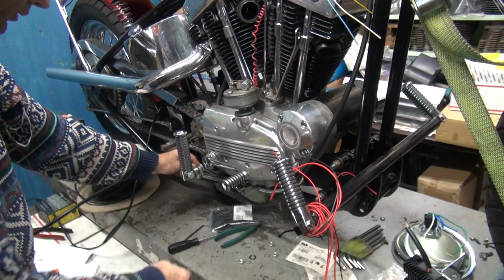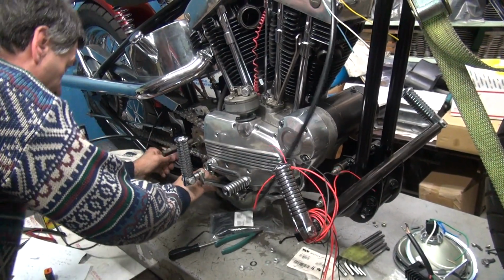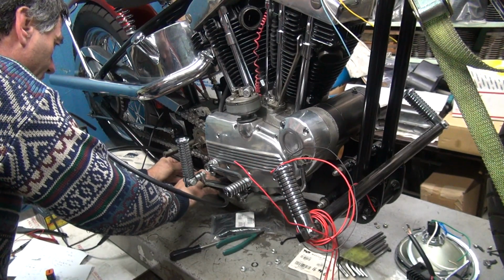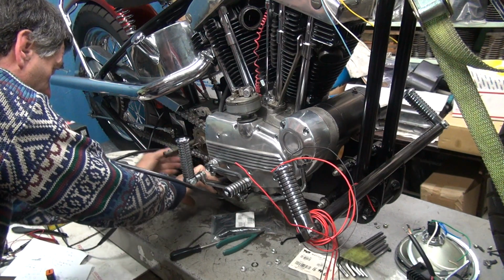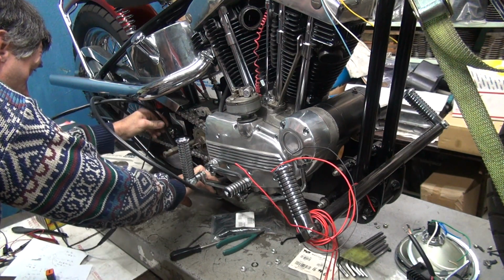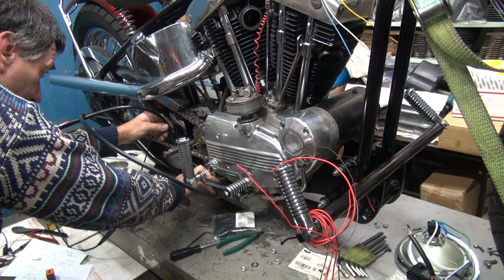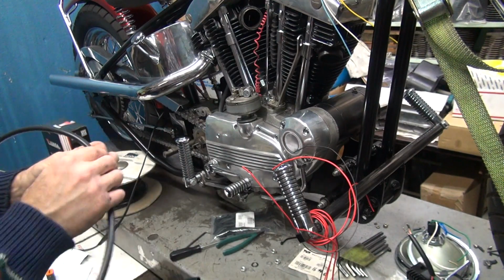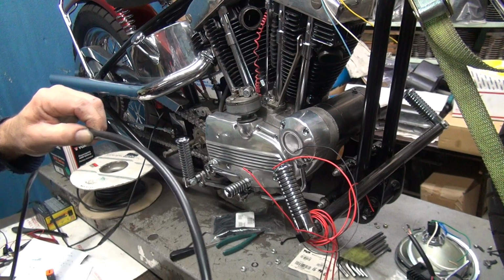So I just got the conduit here. I'm running along to the back of the bike. Now back here I can get away from the chain and the brake lever assembly, so it's going to go underneath the frame, come back around, and come up the tube there a little bit so I can zip tie it up there and hold it up flat out of the way. So probably something in this vicinity for length here. Gave myself an extra inch just in case.